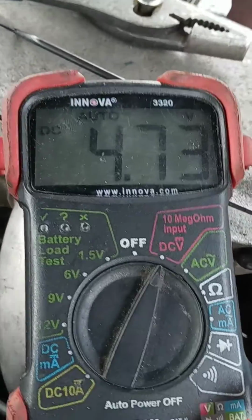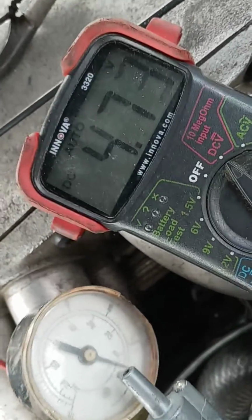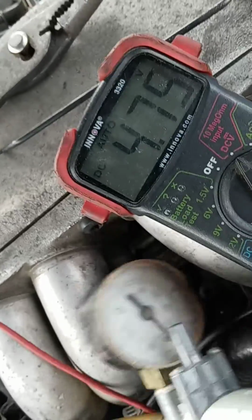And then we're going to test the vacuum and check the voltage all at the same time while we pump up the vacuum to certain specific levels. So right now we're going to watch the gauges here. I can get them both in here like so. We're going to make sure it changes when you start applying vacuum,